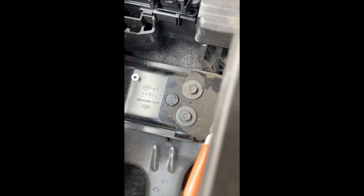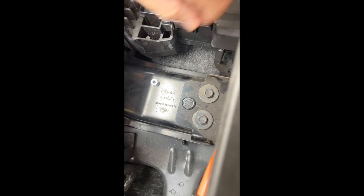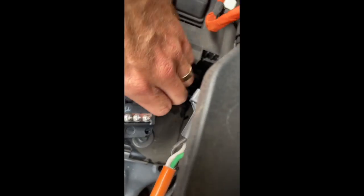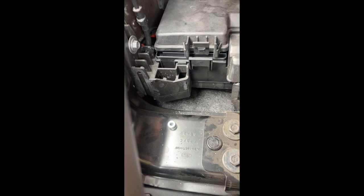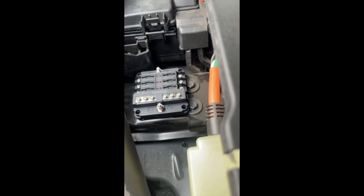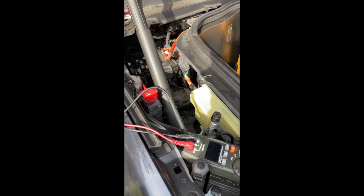On this side there are some open slots that connect to the bus bar up here. I'm looking at installing it right here on this cross member because there's a height difference between here and up here. I wanted the positive side to go towards that distribution block, and the negative binding post will be off to this side where I'll screw it into the frame. I pre-drilled a hole here in the cross member and added washers until I got it to the right height, so now it sits nice and level.